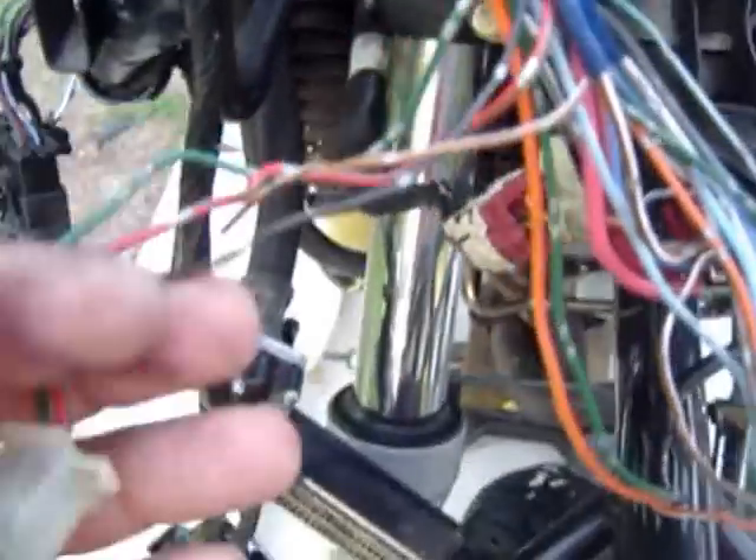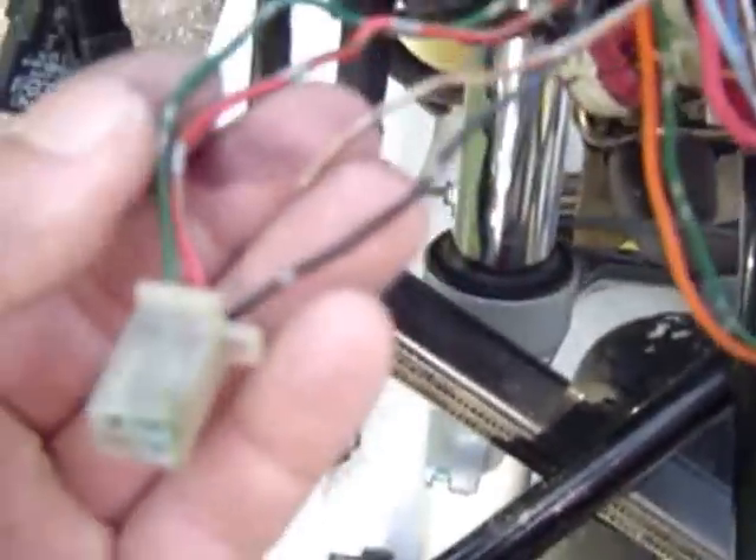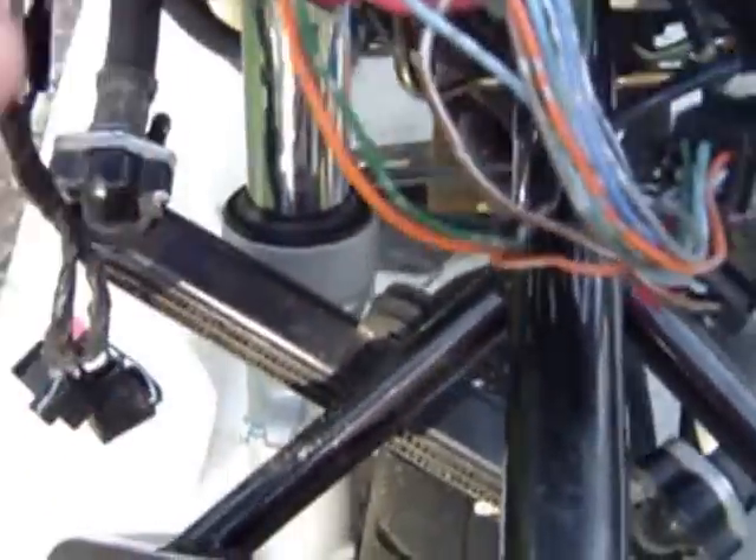The first two connectors are simple: black goes to black, clear goes to clear. The third one is your auxiliary or clock connector. The previous owner had cut some wires and done some alterations on the wiring harness — since I built this from scratch and had to buy the instrument cluster and everything. This third connector is not in use, so those cut wires have no interplay on the schematic or wiring of the bike. The fourth connector is the ignition — it goes to the key and sits into that pod right there.